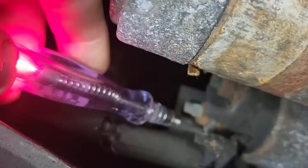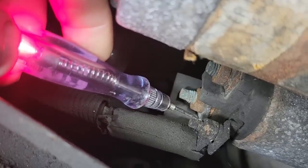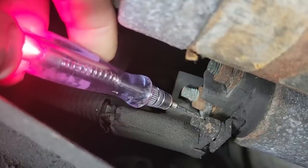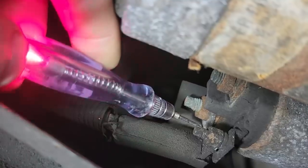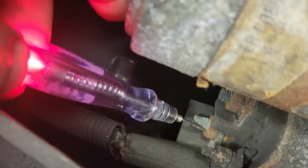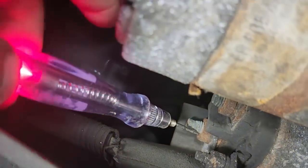This does not need a starter. I'm on the eyelet now — go ahead and crank it. See how the eyelet stays lit? Crank it again. That means our voltage drop is right here, literally right here.